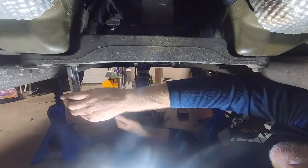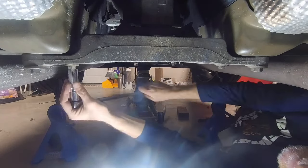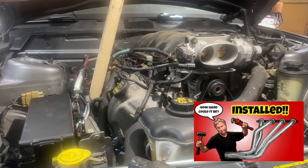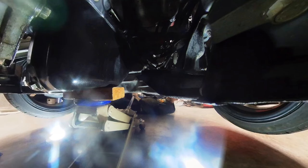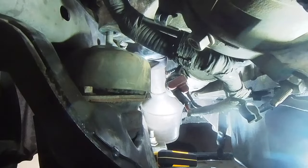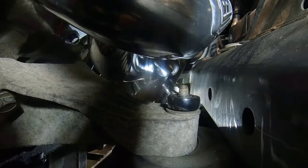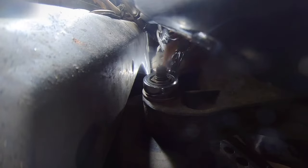Before lowering the engine, I loosened the transmission mount bolts so that the engine will more easily shift side to side. With the headers installed, I used a pry bar to push the engine over. This time I had success by pivoting the jack so I could pull the engine side to side until I got it dropped down on the studs.